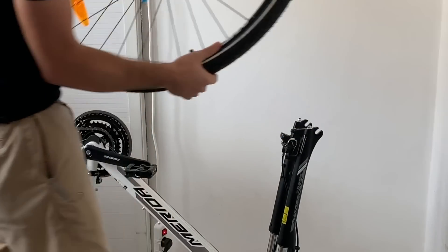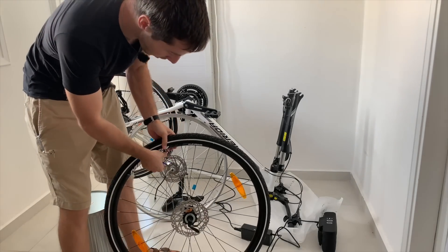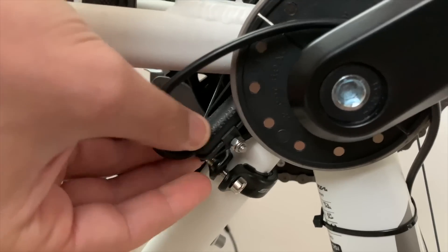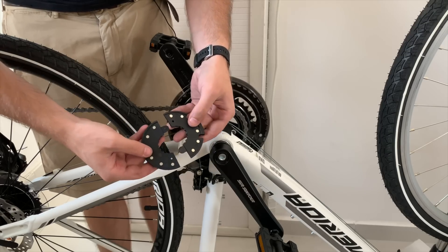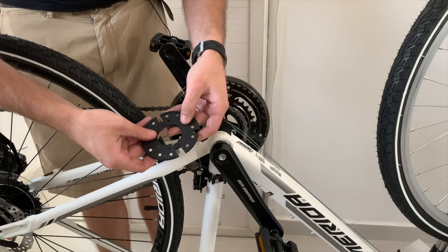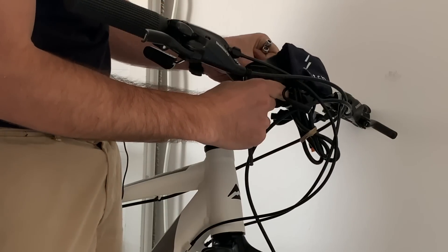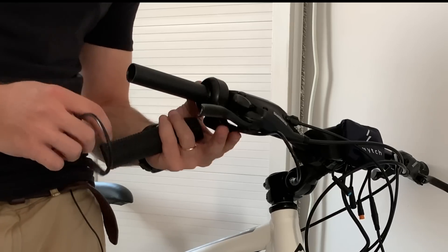You start by removing your old wheel and replacing it with the kit's hub motor wheel. My bike has hydraulic disc brakes, so I just move the disc over onto the hub motor wheel. Then you mount the pedal assist sensor down by the pedal crank, which also includes a magnet ring to tell the sensor how fast you're pedaling. Finally, you flip the bike back over and attach the quick-release bracket to the handlebars. At that point you're basically done, unless you want to slide on a throttle as well.